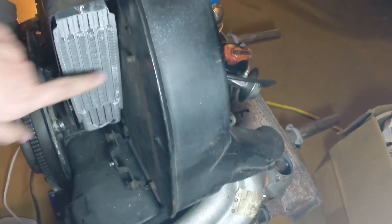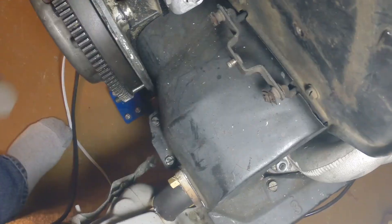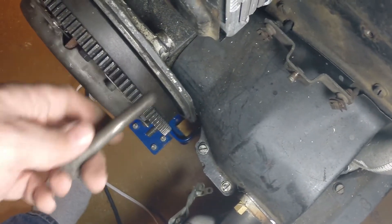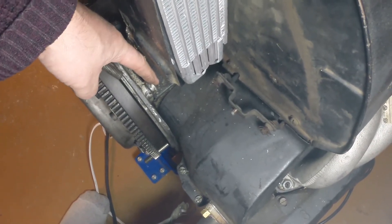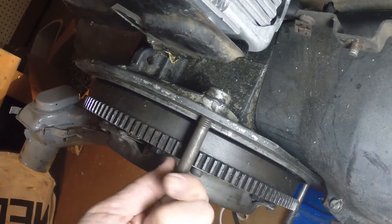Here's the oil cooler for this engine — it's called a doghouse. It sticks out and provides a third separate air supply through the oil cooler. In pre-1971 cars, this was mounted inside the plenum, so there was plenty of room and the bolt simply went through the bell housing with a nut on the end. But with the doghouse oil cooler, there's no way to get to that position from the back — the car wall is right there. So instead, in the doghouse oil cooler installation, there is a captive nut. It's threaded inside, so the bolt just threads in to hold the engine — that's the upper left mount bolt.